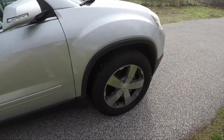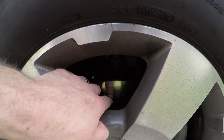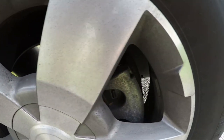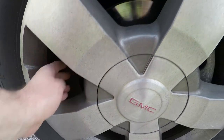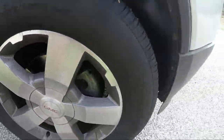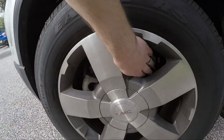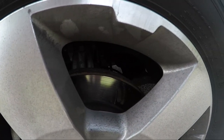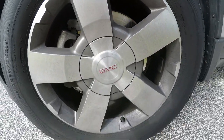Here she is. I replaced these back in October of last year and this thing is warped like a son of a gun. We're getting some really bad vibration in the front, especially when you brake. That one doesn't feel as bad, but you can feel a lot of pitting on it, and this guy is definitely well worn. I'm not a hundred percent sure what happened — I'm going to replace these again today, so that's part of today's update.